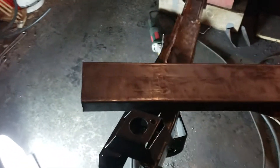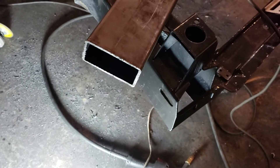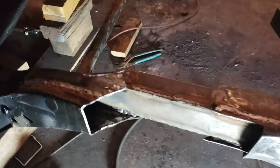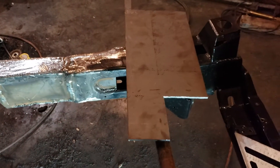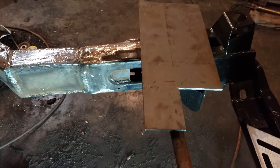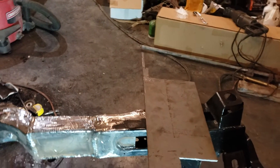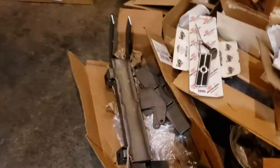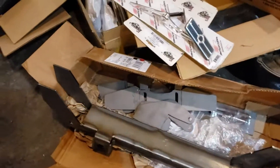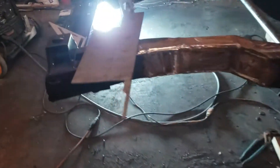I used this two-by-four square tubing and put that in first, then wrapped it with this three-sixteenths flat piece of metal that comes with your Welder Series Mustang 2 cross member. This is Paul Horton's Welder Series cross member — it's all custom. You can order the extra plate; they give you two plates, three-sixteenths thick.